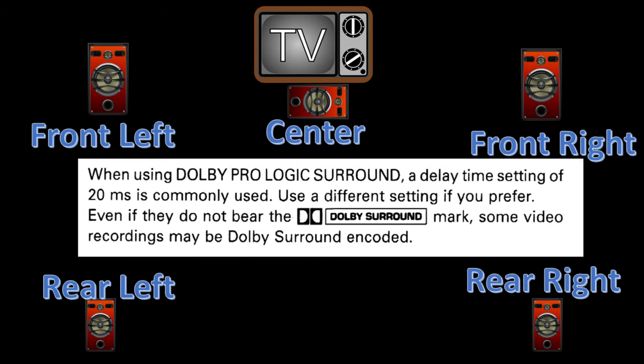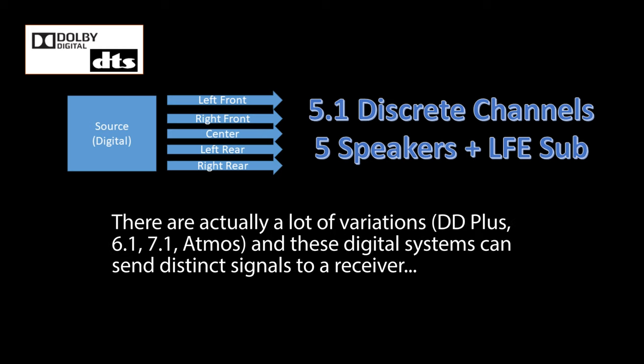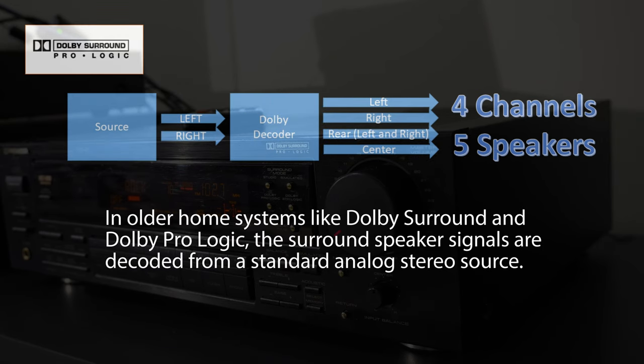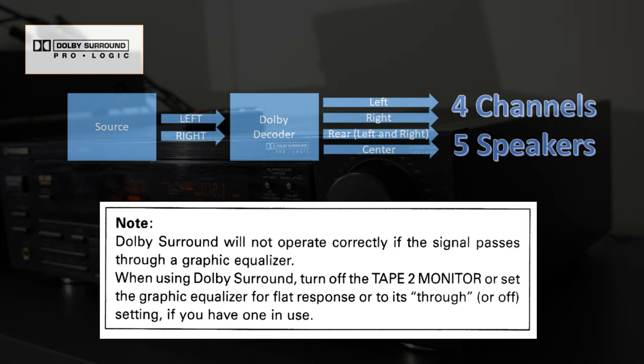Today we have surround sound, but it's a more modernized version. If you're watching a Blu-ray or DVD, the file has separate signals — like 5.1 Dolby Digital surround sound with all those left, front, right channels. This is Dolby, not Adobe. So on this receiver with Dolby ProLogic, it actually uses just a standard stereo signal to derive the surround channels. It takes your left and right channels and through the magic of phase manipulation, it's able to decode a surround channel — the same signal going to left and right rear — and a center channel for dialogue. Dolby ProLogic had that center channel, whereas Dolby Surround just had the rear channel. The whole idea is it creates this effect to make you feel like you're in the middle of the action.